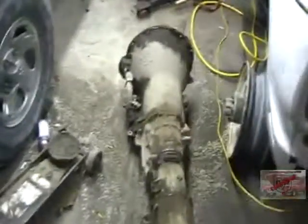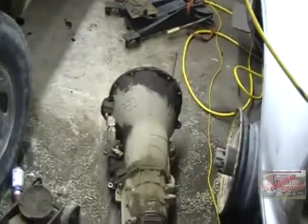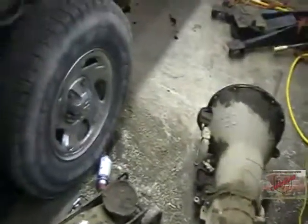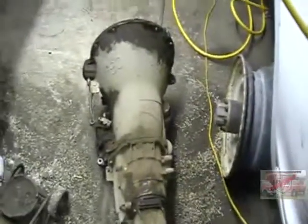It's a junker. Will I rebuild this one? No — this one's had brake fluid run through it and I'm not going to mess with it. Brake fluid generates heat in the transmission. It actually turns the aluminum internals a dark color — you can tell it's burnt. I swear it egg-shapes things in there because of the heat. As far as I'm concerned the transmission's junk; I wouldn't rebuild it.